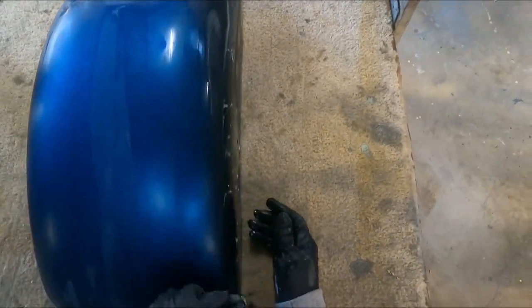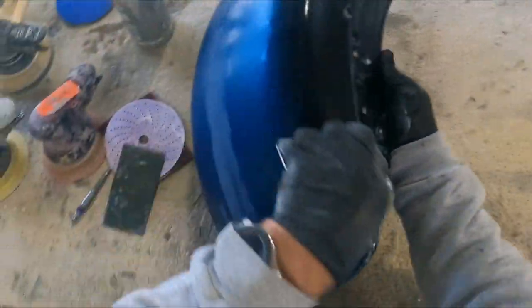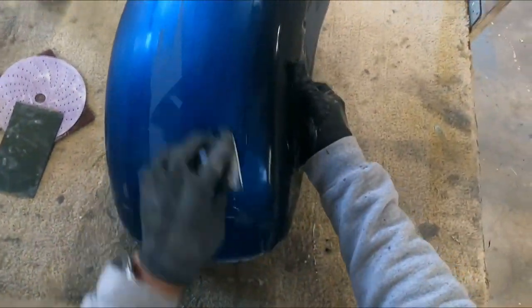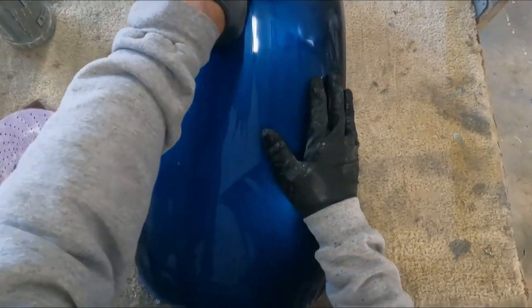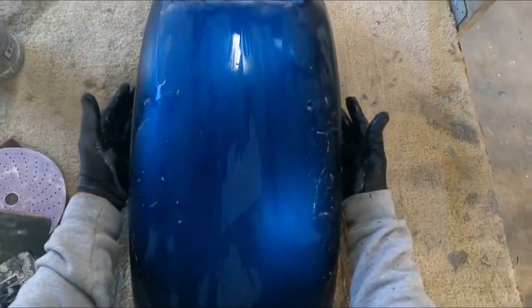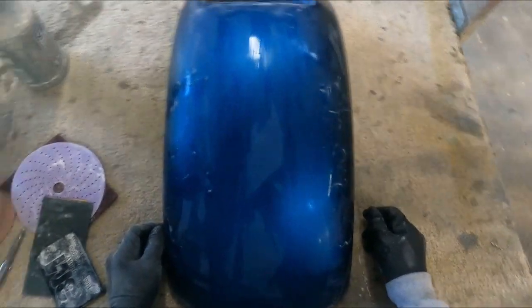As you can see, this is nice and smooth. 1000 grit is great — no peeling problems. Being that this is a day old and using a fast-to-medium reducer, the new clear will adhere very well because the clears will meld in together. Then you want to wipe it off real good, make sure you get all the clear residue off — we usually use wipe-alls or paper towels. This one's ready for graphics. I'll tape off the stripe areas and then spray the rest black, pull the tape off, and we'll have metal flake stripes.